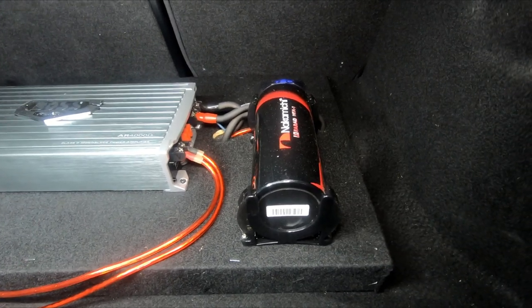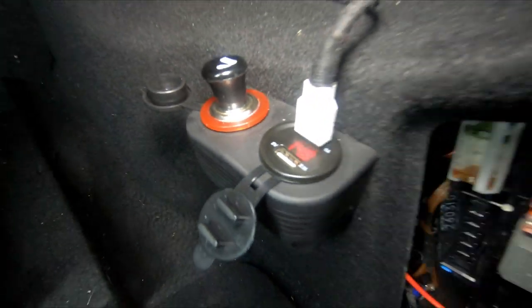And there you have it — how to test for 12-volt switched power using simple everyday tools like a testing cable, and which fuses you can use: number 37, 71, 72 (an empty slot), and the one above number 80 (also an empty slot). If you want more certainty, do additional research or ask Mercedes. I've used this setup for almost a year with no problems. If you liked this video, please give it a thumbs up and comment below with anything I missed. Thanks for watching — this is Mike with Mikey's Logs, signing off.